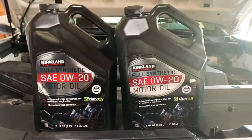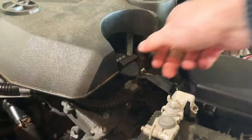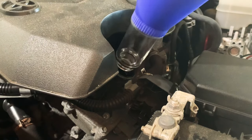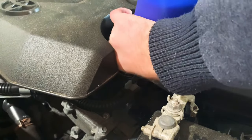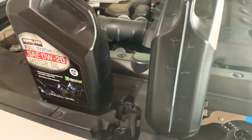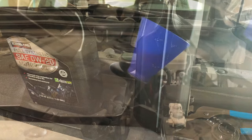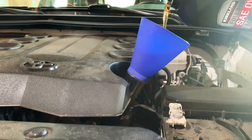Now it's time to add oil — just make sure you use the recommended oil weight of 0W-20. Remove your oil filler cap; you can see on the cap it says 0W-20. I like to use this Motive X funnel made for Toyota — I'll leave a link in the description below. I have a full five quarts in one bottle and 1.6 quarts in another for a total of 6.6 quarts, then just fill it up.